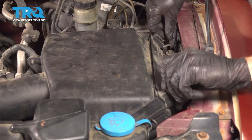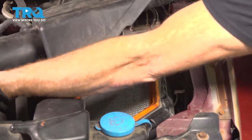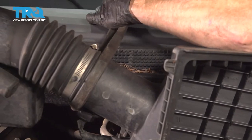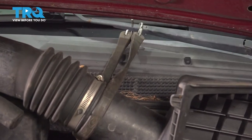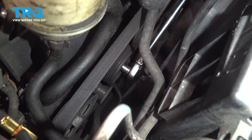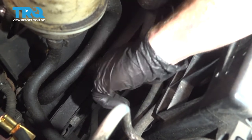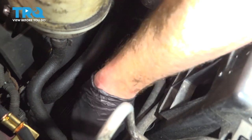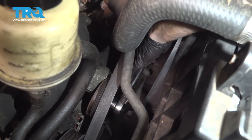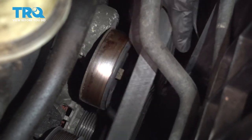Now that we have the hose off, continue on to the air filter box. We'll open up both these clamps. Now we can take this entire unit and shift it up just like this. We'll use a bungee cord to hold it up. We'll continue on to the serpentine belt tensioner with a 14 millimeter. Get your tool onto the center bolt and then turn it counterclockwise to release tension from the belt. Now we can fully remove our serpentine belt from the area.